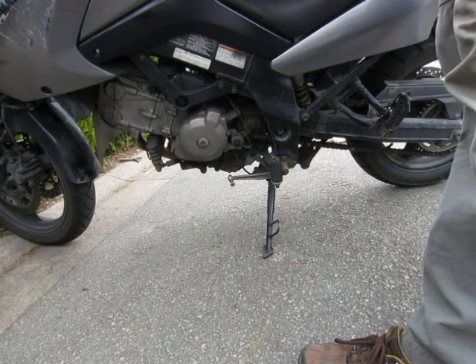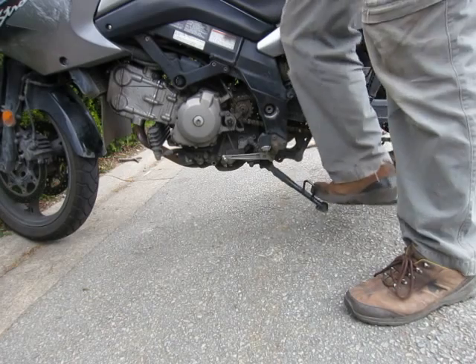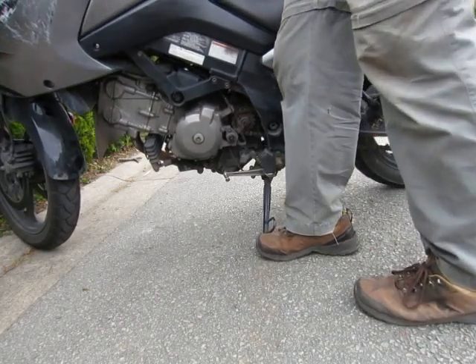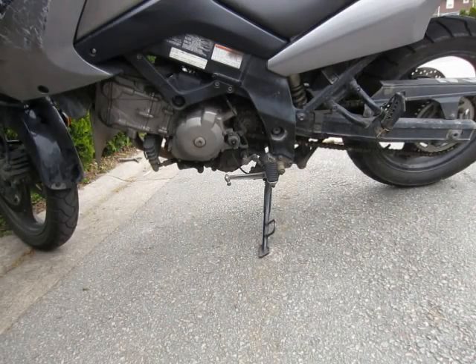To lift up the bike, two things: the kickstand should be all the way out — not halfway, all the way there — to make sure the bike does not roll forward and you have a solid footing. The kickstand is strong enough; it's not going to collapse underneath the bike's weight when the bike is tipped over. Also extremely important — don't ignore this — the front wheel must be firmly against the curb or against something that doesn't move.